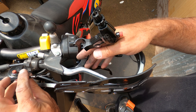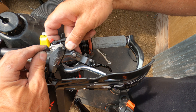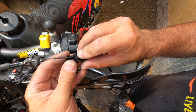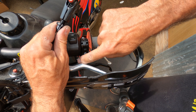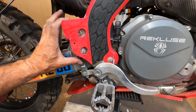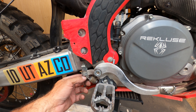Now we're going to install the brake cable into the brake and get the length correct — it's pretty simple. There's a slot, it drops in just like your clutch cable; all this stuff is slotted and just drops right in. Then we pull the clevis pin off so we can take the brake pedal free from the master cylinder piston. There's a little cotter pin back there that we unbend and pull the spring off.